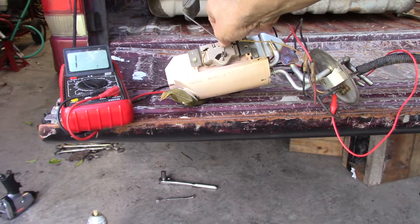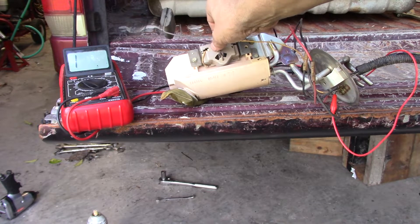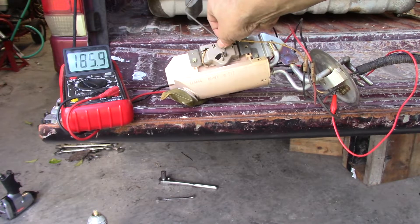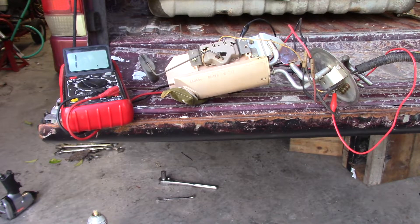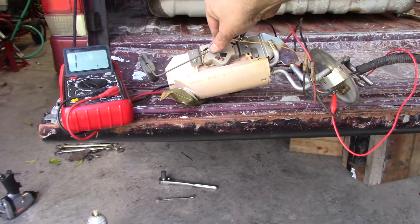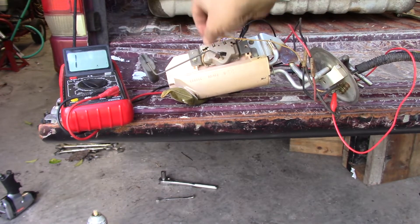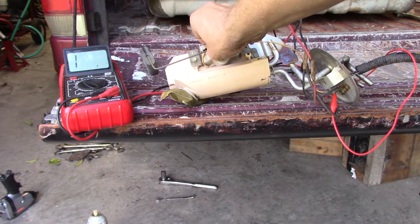But this is beyond ridiculous — this shouldn't even do this. If this was a position sensor on your engine, like a throttle position sensor, you'd have to throw it in the garbage because it's not going to work good. I just let it drop back down. It should be reading 22 ohms, but again it's open. If I hold my tongue just right, I can get it.